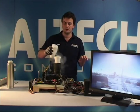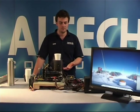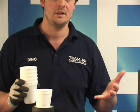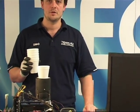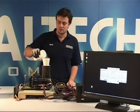Now, an important thing to note here is when you're approaching the finish of a benchmark, be careful how much liquid nitrogen you pour into the tube, because once the benchmark finishes, there will be no load on the CPU itself, and the temperature will drop down considerably more than normal, because you've got less heat underneath the tube that you have to cool. So be very careful near the end, and try not to put too much. For example, right now we're at minus 77 and this test is about to finish. If I have a big pour now, during the test the temperature will still be within maybe minus 80 degrees. However, if this test was to stop, my temperature would actually rocket down to minus 85, even minus 90, depending on the cold transfer with the pot you're using.